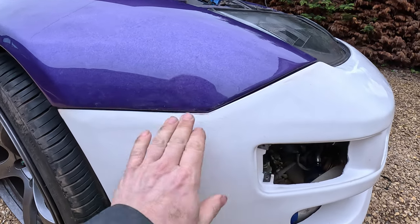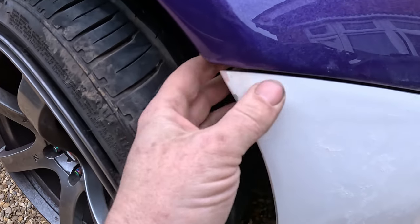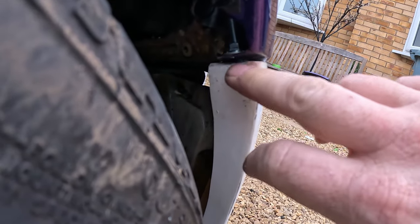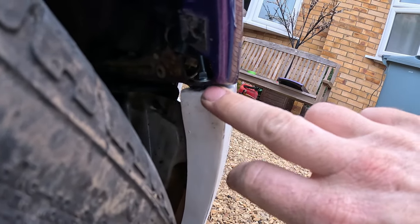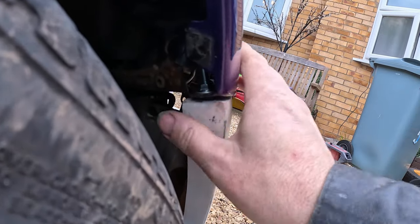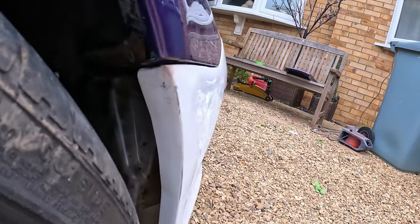So we've got this side on. This sits reasonably flush. The wing's actually got a bend in it, I think. This side here, I put the bolt in and it's close, right? Because what problem is, it's these tabs. Because there's the gap there, it needs to sit in there. It allows it to, it kind of pull the holes in the right place, but it kind of pulls it in like that. But if I was to basically manipulate that tab so that the tab goes in like that, that should solve that.